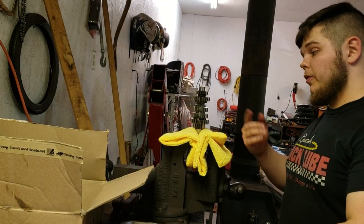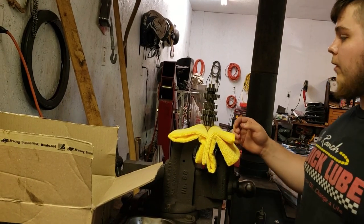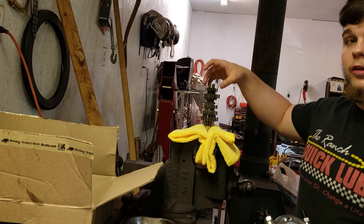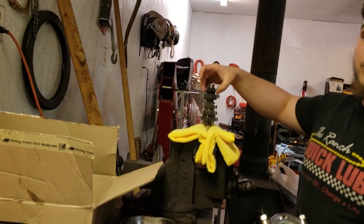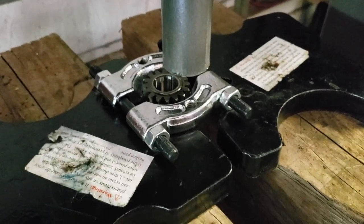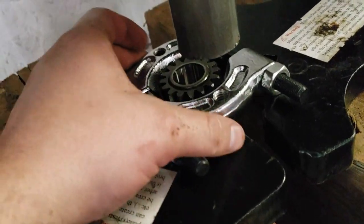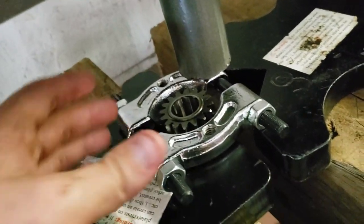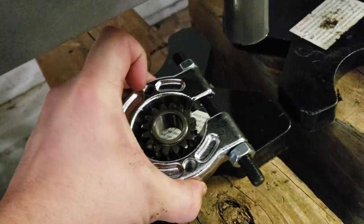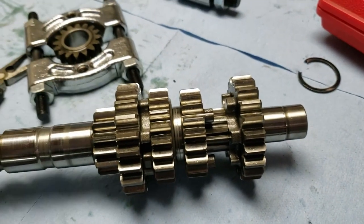To get started, I went ahead and put the main axle in my vise with really thick microfiber towels on both sides to make sure I don't score up the shaft. I'm going to be using the bearing separator to sit it up underneath the gear so I can pull the reverse pinion out. I actually ended up using the press because I could not get the vise to stop the shaft from turning. So I used the bearing separator to hold the gear and the press to press the shaft out. I'm assuming this has never been off on my Raptor before because this thing was stupid tight, but it is off now.